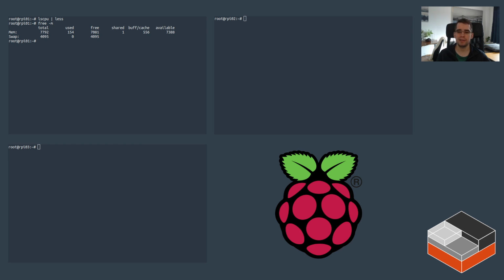a small micro SD card for the operating system, and then I would very strongly recommend a fast USB 3.1 mass storage device, whether it's a USB SSD or a fast external drive or something. The built-in SD card is quite slow and doesn't really perform well for running a bunch of LXD instances like what's going to be happening here. All of those are running Ubuntu 20.04 server, and that comes pre-installed with LXD, in this case LXD 4.7.